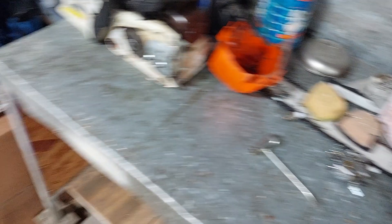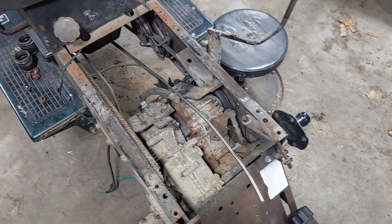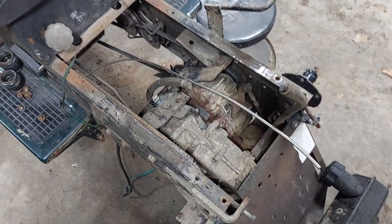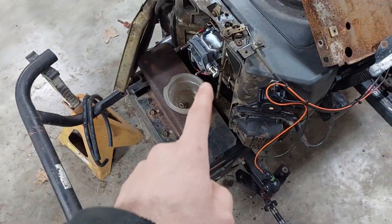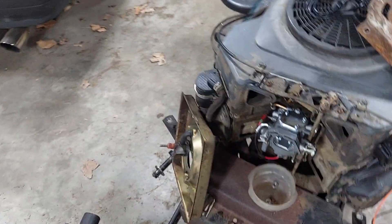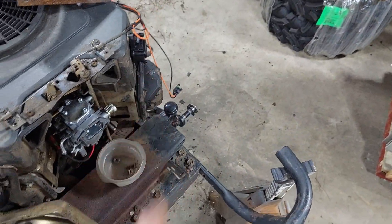I think we're in a good spot with that bracket and body — I'm going to shoot some spray bomb on it in a couple minutes. The new carburetor came in, so I've got to get that running. On this one we have a new fuel grommet and inlet nipple. I've pre-cut the stainless steel quarter-inch fuel line, removed all the old fuel system. New carburetor is installed, new crank breather is installed, and the new fuel pump is installed.